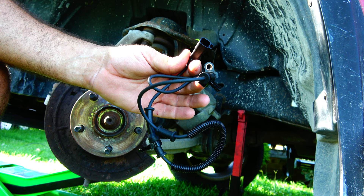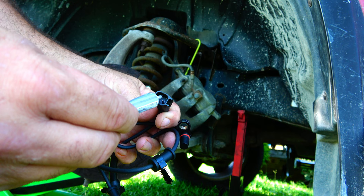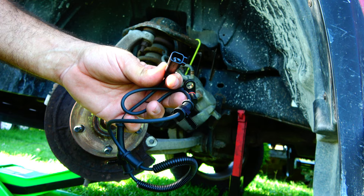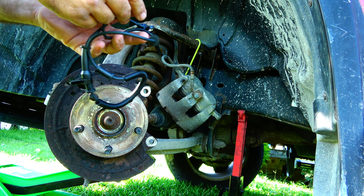I've got my new sensor here. Comparing it to the old one, the connections and things are identical, so it is the right one. I always like to compare my new parts with my old parts. I'm going to put just the smallest amount of dielectric grease on the plug-in connector — it's just Permatex dielectric grease. I do that with all my electrical connectors.